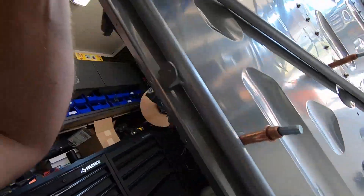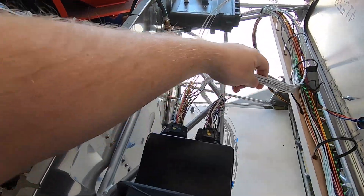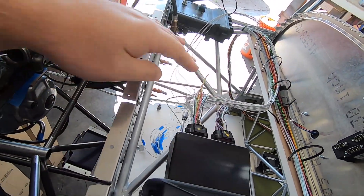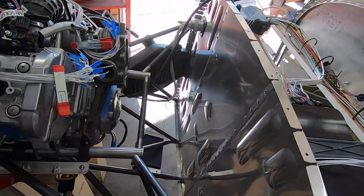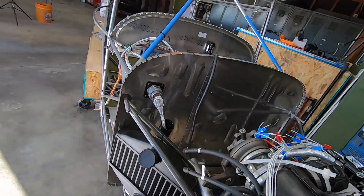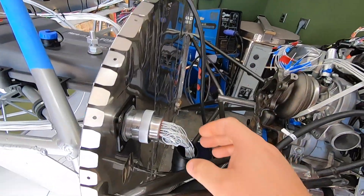Links will be in the description to all the sites that I mentioned in this video. I've got most of the engine harness passing through the bulkhead, with the exception of a few after running out of 16 gauge wire. You'll see my temporary wire chase there — it's got zip tie loops, just helping me keep everything in place, but it will all be ultimately removed when the harness gets tied up.